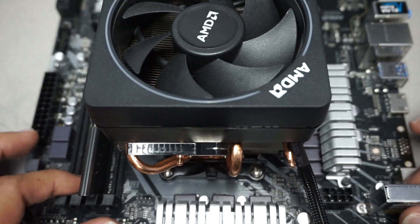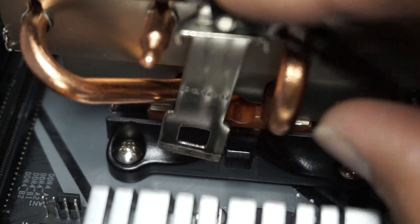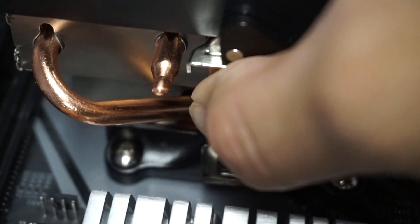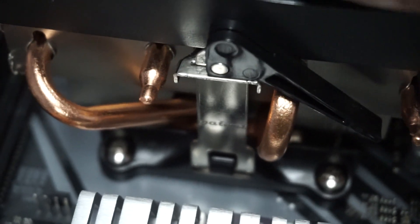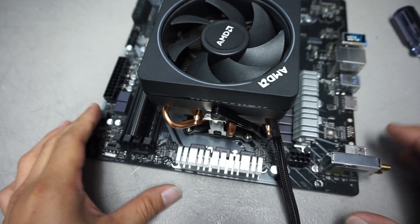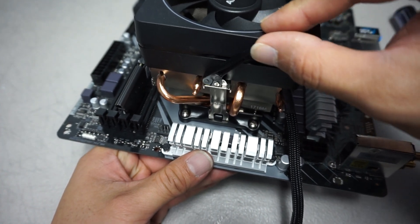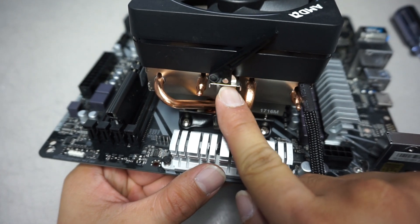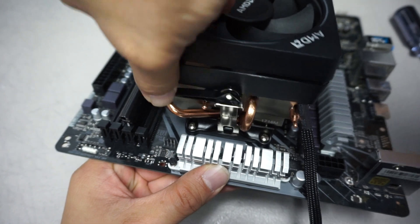Now for the other side. Make sure that the lever is moved this way so you have the most slack for this bracket. If you do it correctly, very little pressure should be needed — the bracket should just clamp onto that hook. Make sure everything is seated down properly. Once done, this bracket will move: when you flip it, the shape puts pressure on this part and pulls the whole thing up and the heat sink down. Flip it towards that side; if it gets a little stiff, don't worry.